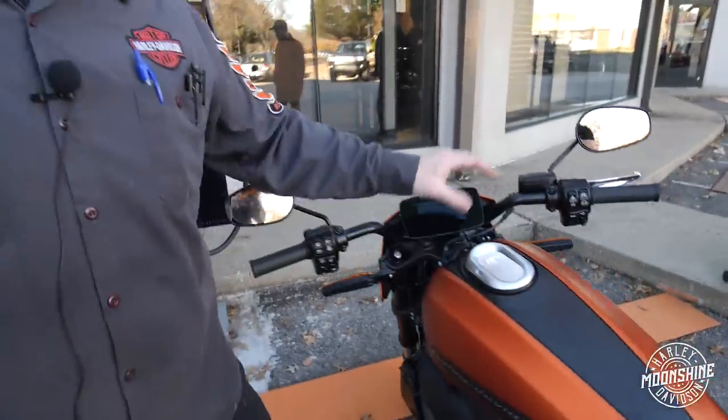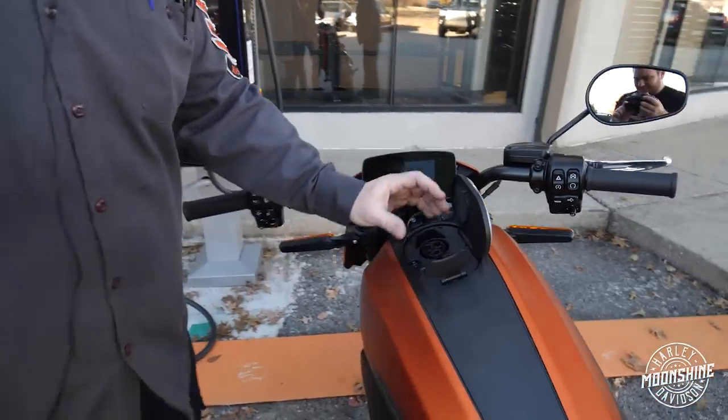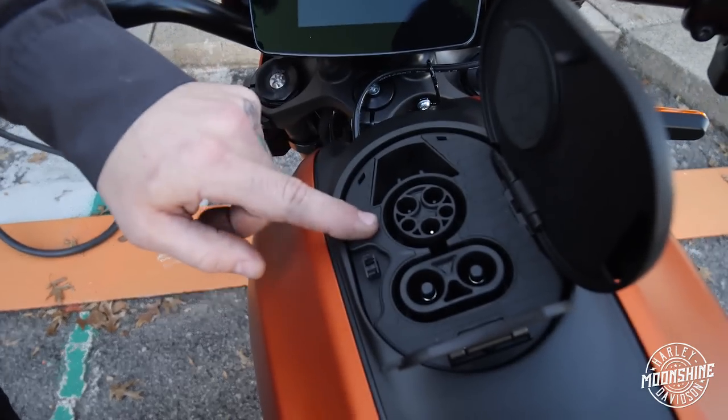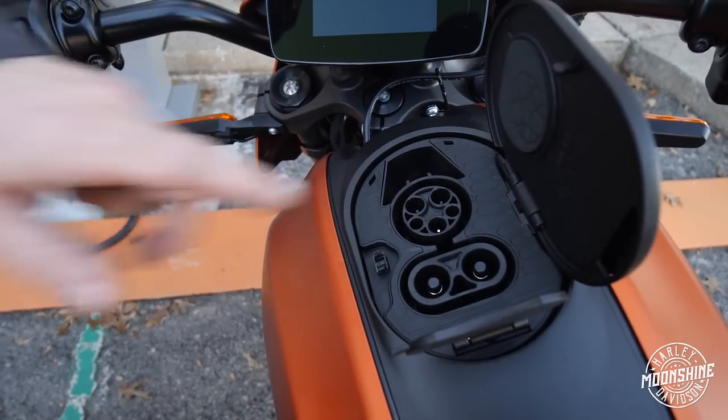This has level 1 and level 3 charging. We have the DC fast charge, which is level 3, and the AC charge. Now, for your warranty to be valid, you want 4-to-1 AC charging versus DC fast charge. The AC charge will charge this RESS to complete capacity in right around 8 hours. Now, this can be plugged right into a wall socket at your home. It needs around 11 to 15 amps.